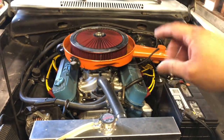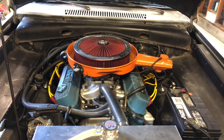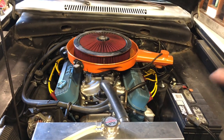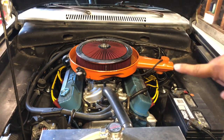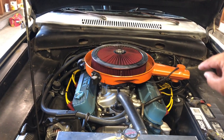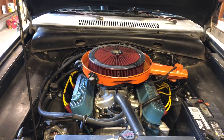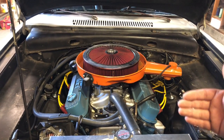That's a quick overview of the engine. The whole combination of the engine and the automatic transmission probably works out to about 280 to 300 horsepower. But to the wheels, because this transmission slips a lot — these are old-school automatic transmissions — the torque converter, which transfers power from the engine into the transmission, slips a ton.